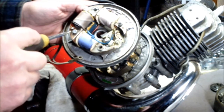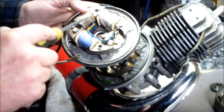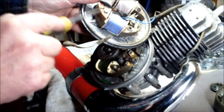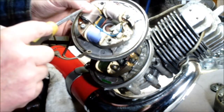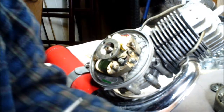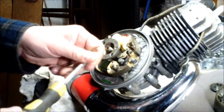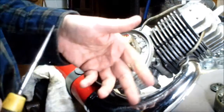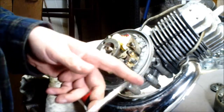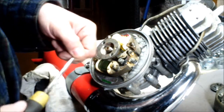And this one, bridging the two of them, this is your ignition coil on the three coils. All that does is just do the ignition exciting — it doesn't do anything else. The ground is actually right there at the end of the coil — you can see it's soldered to the actual coil itself. So these ones, you do not have to run that jumper in order to get a spark. If you just have a regular 6 volt, the old system with the external coil, the top coil is for lights and the bottom coil is for ignition. On the ones without the external coil — which are old, old, old two coils — the top one is ignition and the bottom one is your accessory coil. And that's about it for the coil.